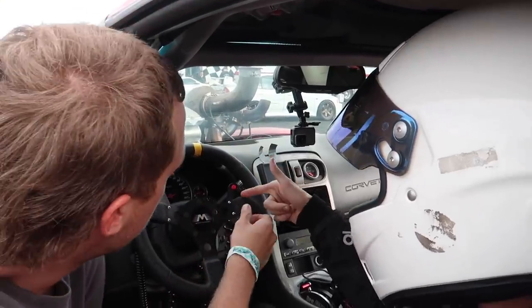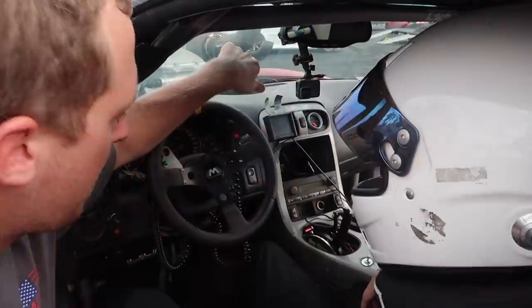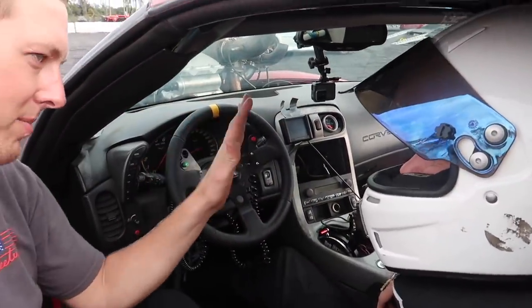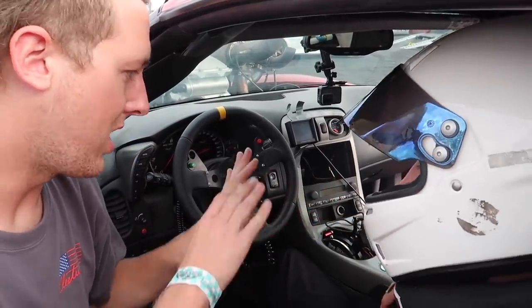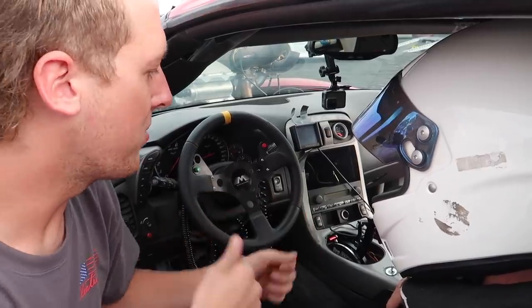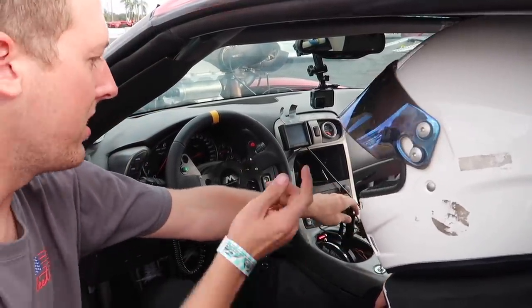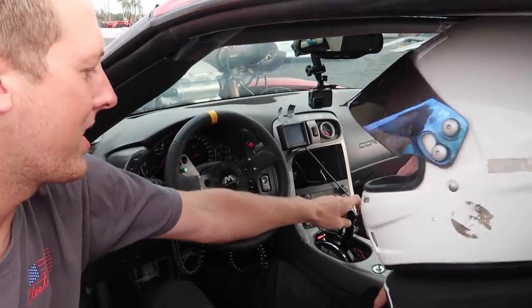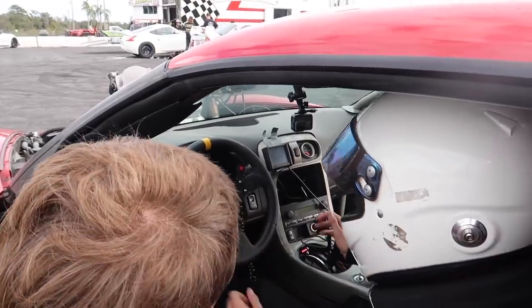Oh, I thought this was me doing a burnout in the box. No. Okay, let's start from the top. You're gonna get in the burnout box. I'm gonna pull you forward, then I'm gonna stop you. You're gonna be in first gear. I'm gonna start to power brake it, so foot on the brake, foot on the gas. The car's gonna spin the tires. When I give you this signal, smack that into second. And when I give you this signal, roll out. It doesn't need a big burnout. It doesn't even need a good burnout. So I'm gonna do a burnout in first, and then go into second.